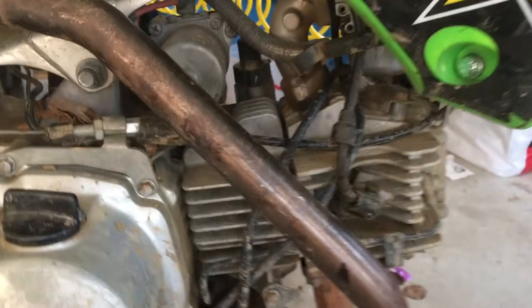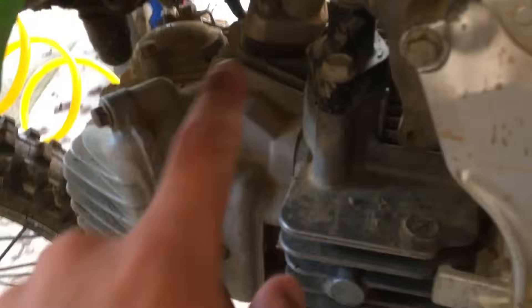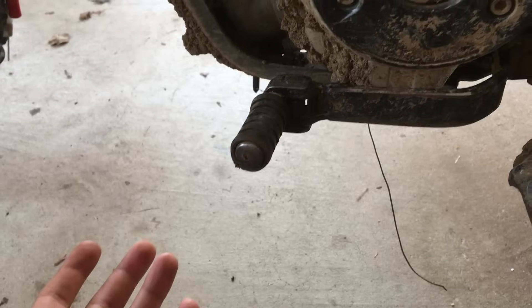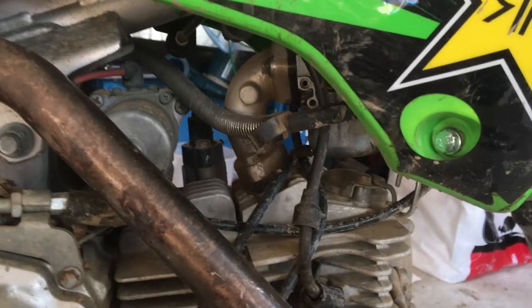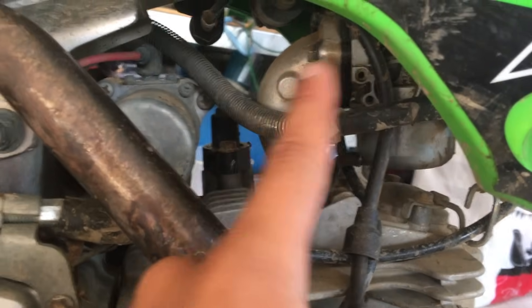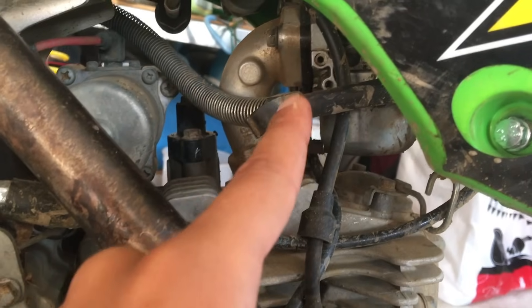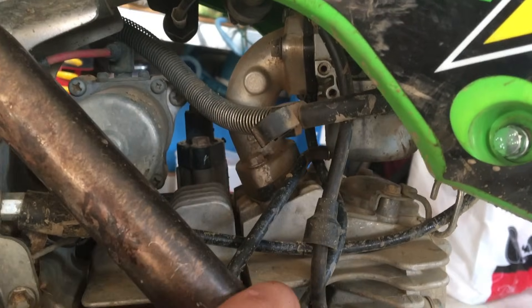To check it, all you have to do is come over to the other side. Don't forget to tighten the overflow screw back up, turn on the gas, and see if it drains out. If the compressed air technique does not work, what you're going to need to do is take apart the carburetor, clean it, and try to figure out what dirt and debris is keeping that float valve stuck open.